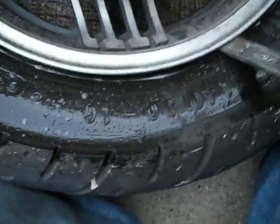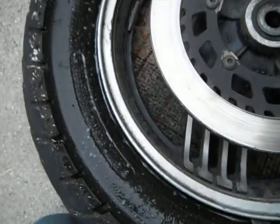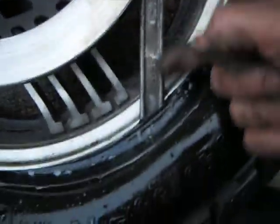All right, so you take one of these guys like this right here. See that, the short one? I like these little ones. What is that, maybe 8 inches? 6 inches. And what you do is you push down on one side of the tire to get the side opposite of the tool that you're going to move with. You want to force that down into the center of the wheel because there's a low spot there. And you just get underneath there like that, and you just go like that. See how I pulled that up? That's tucked down into the center of the wheel. This is pulled out and tucked underneath the rotor.